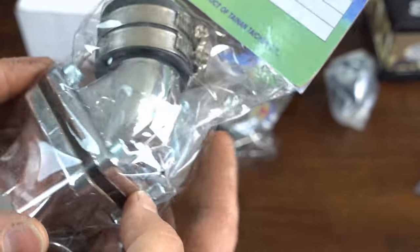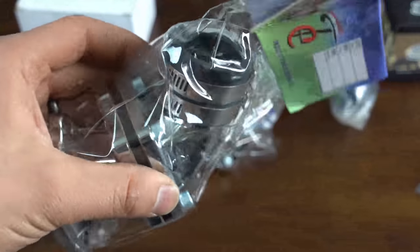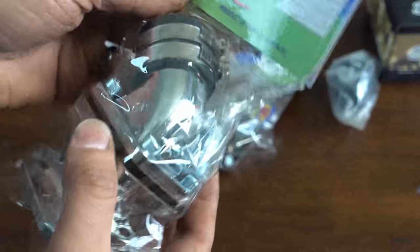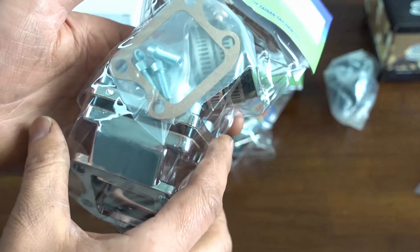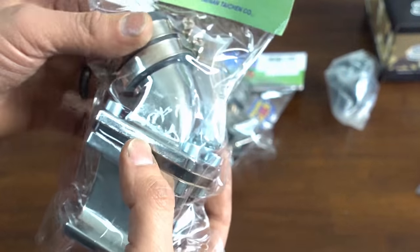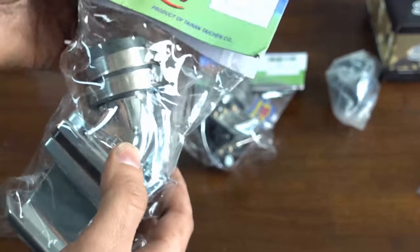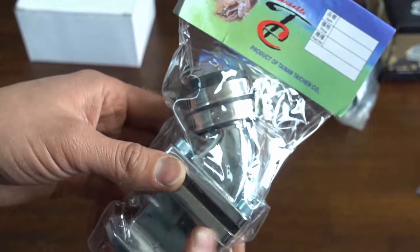This is going to fit your 1994 to 2001 Honda Elite, and then your AF18, AF16, AF25 style, and AF28 style Honda Dio as well. It allows for a PWK size carburetor — larger size carbs. The benefits of this are it's larger: you've got a bigger reed cage and it allows you to fit a larger carburetor, because your OEM intake manifold is pretty small. If you run a 72cc or larger, you definitely want a performance intake manifold.